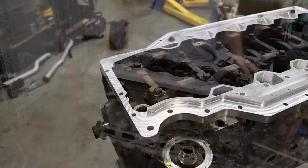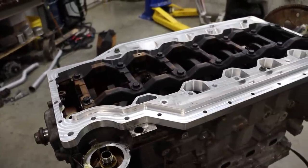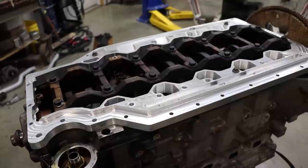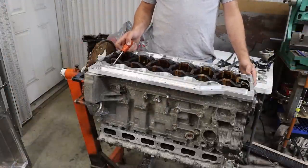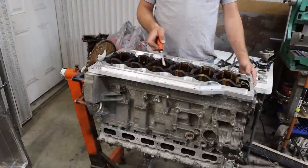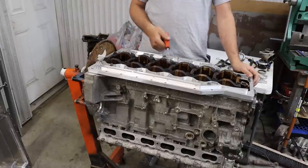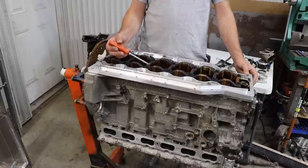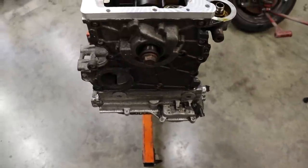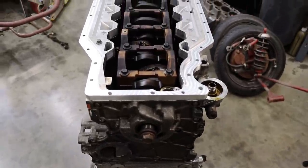Like I just mentioned earlier, one of our goals with this oil pan was also to girdle the block, and therefore we went with this two-piece style design. Now this upper portion is made out of a 1-inch piece of 6061, and we made it so that it used all of the original oil pan bolts, and hopefully it will girdle the block and keep it from flexing too much. This upper piece also allows us to move the lower oil pan bolting face out around 2 inches, and this is effectively our kick out in the oil pan.